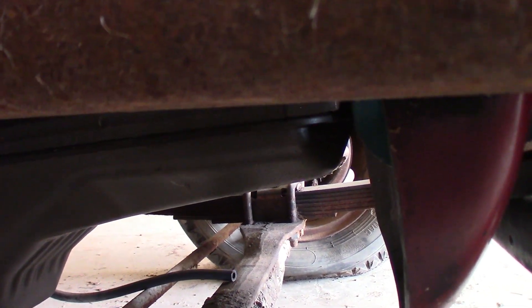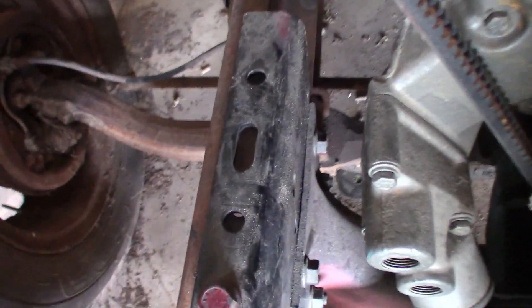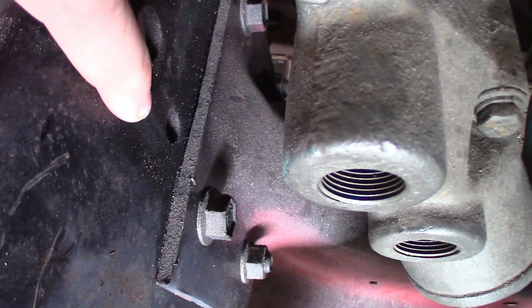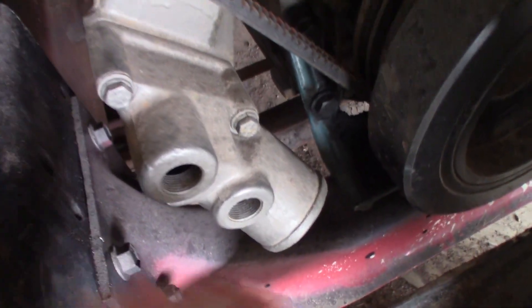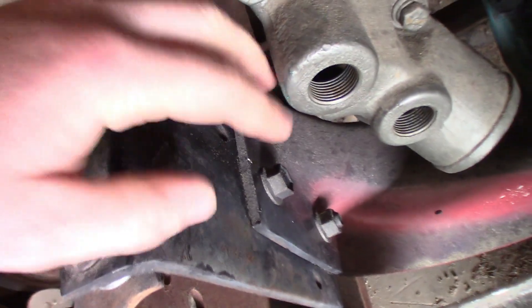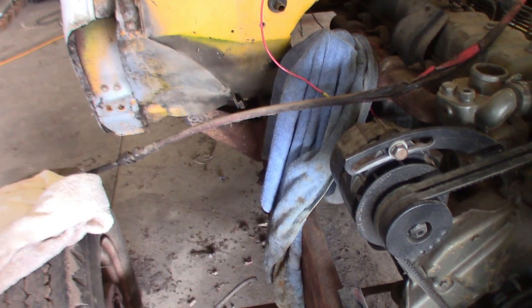So we need to move the engine up a few inches. The way we're gonna do that is all we have to do is drill new holes — this is the engine cradle, this is where it's mounted — move it up, and then in the rear we're just gonna do spacers to move that up the amount we need.